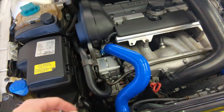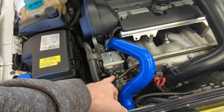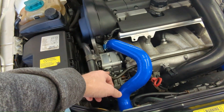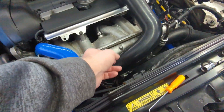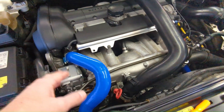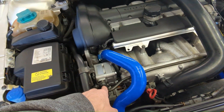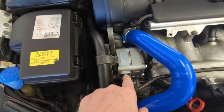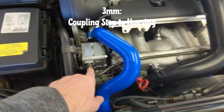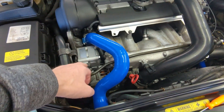But again, it always made that little whine — I really didn't like it, especially on a cold start. When I went to put this back together, I started threading it and I'm like, oh my God, this is tight. I am cross-threading this. I'm so afraid of this thing. Get everything disconnected, take the bazooka tube off so you can get it at the right angle to go square. On Vita, it says this is supposed to go until the tip of the housing is about three millimeters from the unit. And I chickened out — no way, this thing is tight. I started the car up and this thing leaked like crazy, stuff going everywhere.